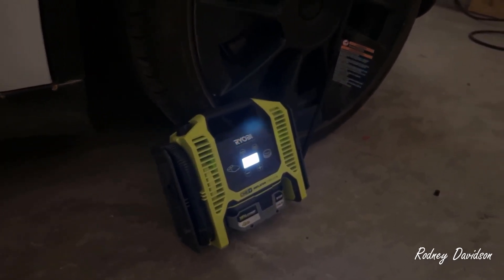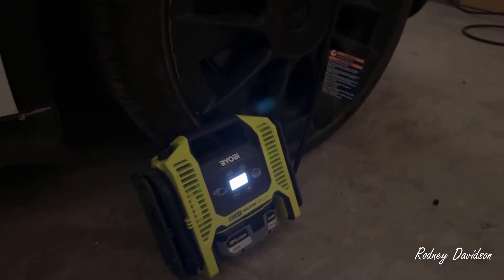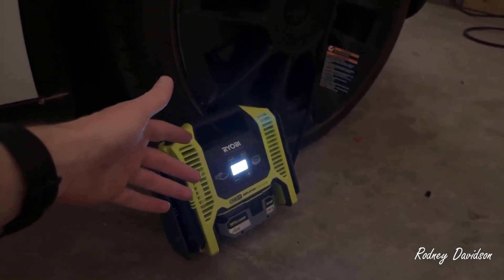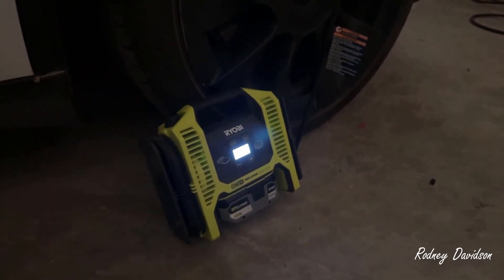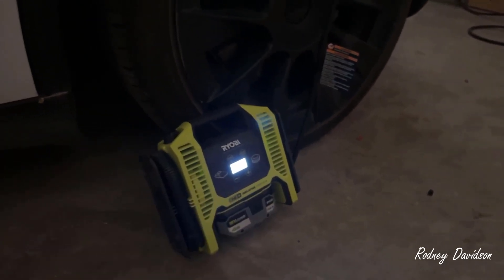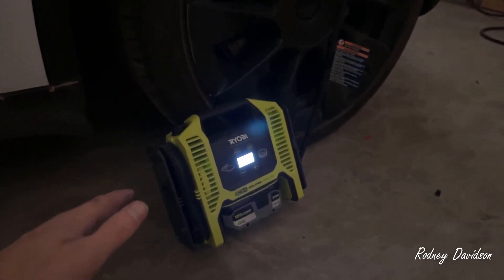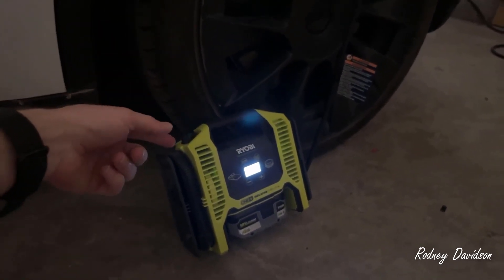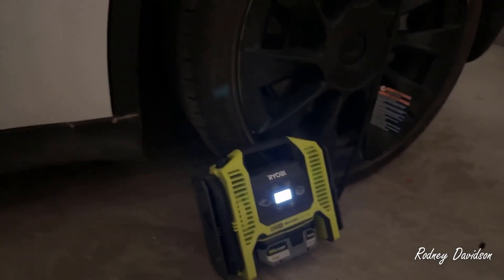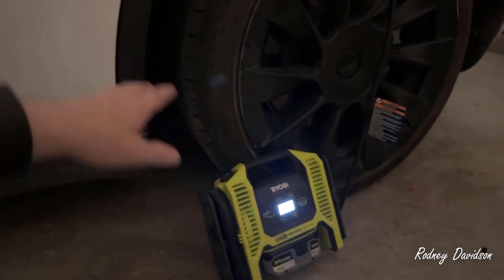So that's the last tire — I filled all four of them. I just wanted to show the feature where if you set it to stop at 40, like I did, it will just shut off when it reaches the pressure you set it to. I set it to 40 PSI. I also timed it: it takes about seven seconds for every half PSI that you're adding, so about 14 seconds if you want to increase one PSI — that's on these tires. I don't know that that's universal.